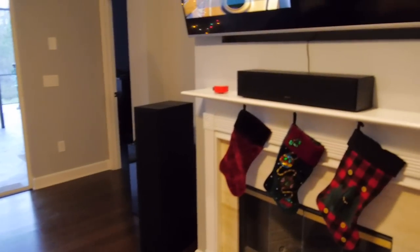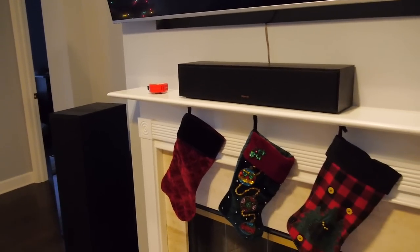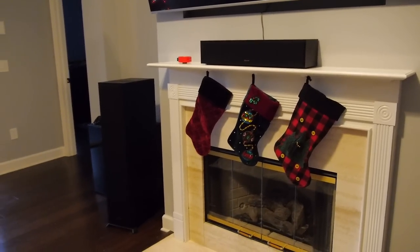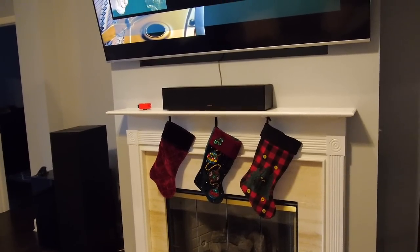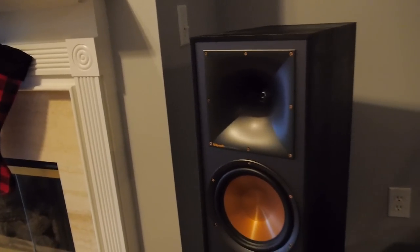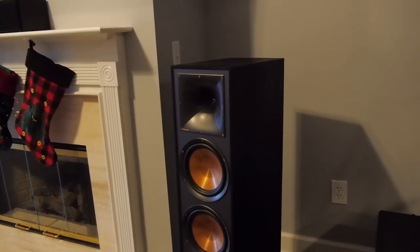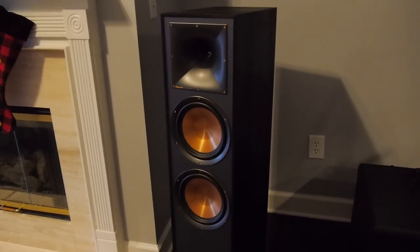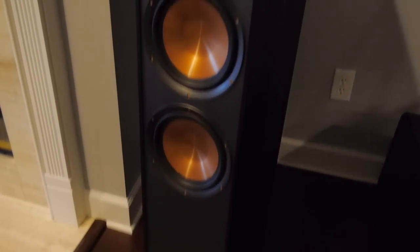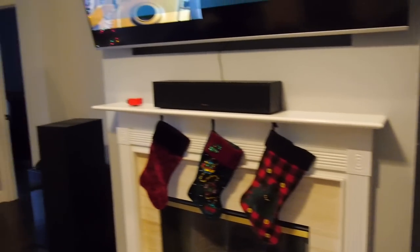What we're going to set up now is called the triangle. A good place to start is an isosceles triangle — equal distance between the speakers and to your ears. And I mean to your ears. You need to use a tape measure for this. The measurement between the speakers is to the center of the drivers. These are Klipsch reference series and all their drivers are centered — two woofers and the tweeter. If you have an offset tweeter, which is common on some speakers, don't use that. Measure from the center of the speaker cabinet.